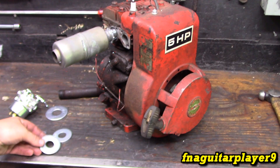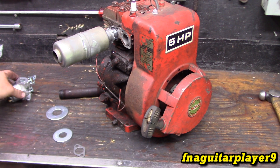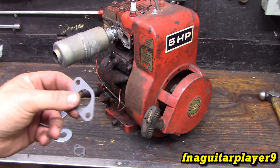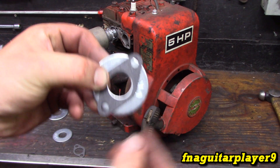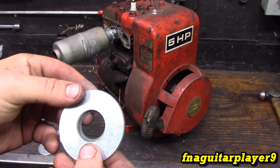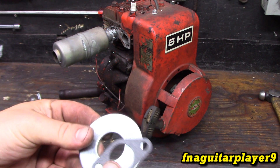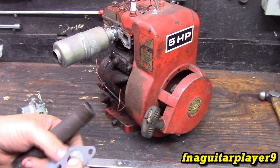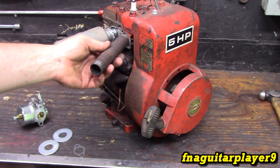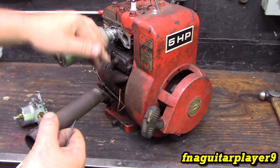After we get done it'll be surfaced a little bit. The carburetor side is actually just a little bit bigger in body, but the throat of the carburetor is smaller, so the gasket is just made that way. The screw hole spacing is a little bit wider, so I can't decide whether to use this one and just notch it with a washer, or go with the big one which is too big — but it doesn't really matter because the pipe will fit inside it. Then just drill the holes and cut off the excess. This 3/4-inch pipe will fit right in it so it'll be easy to weld.